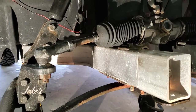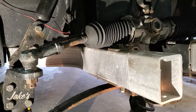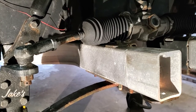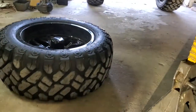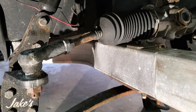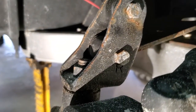We have a new and improved greasable bushing kit we're going to make available to wholesalers and retailers. The problem we suffer with this particular Club Car Precedent model is the cheap rubber bushings they put in the upper control arms. Now that we're getting cars that are bigger, with longer bigger tires and faster — this is a 33 mile-an-hour car — we're seeing more and more problems with getting the alignment to stay where we put it. The cheap rubber bushings allow that upper control arm to move a little bit inward, which makes it move quite a bit outward.